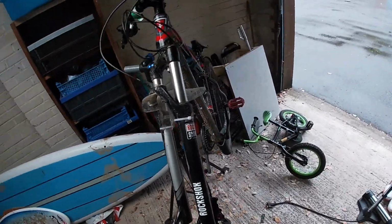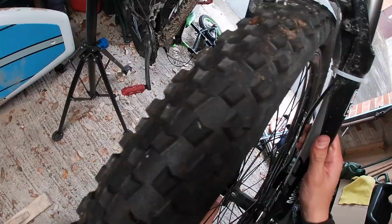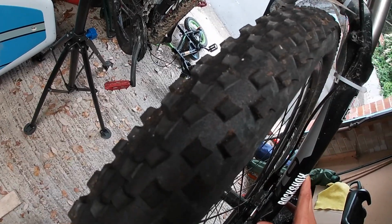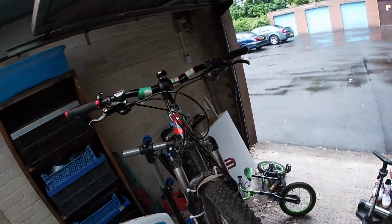After cleaning your disc up, pull your wheel up, or however you put your wheel on, and put it on. Make sure it lines up in your brakes, push it up, or whatever you need to do. You see on my pinky, I have a lot of grease on my hands, so now I know I shouldn't touch the discs, because that will dramatically affect the braking power of these new brake pads. Oh, it's got a bit of resistance there.